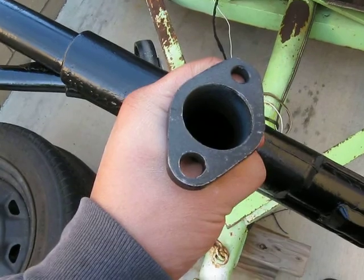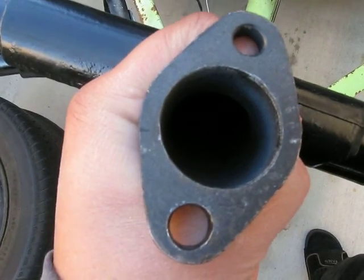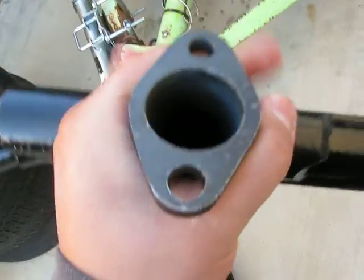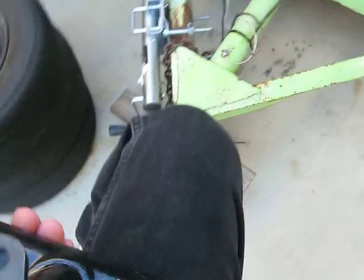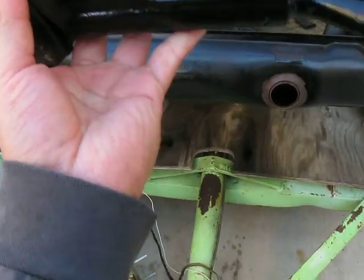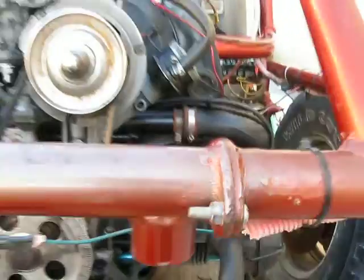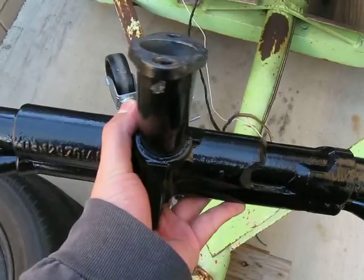Now here's my question — I think I might have something from Europe. This manifold is meant to mount the newer replacement H30/31 PICT carburetors, or the 30 PICT-1 carburetors — those small carburetors. I didn't pay attention to that because it's a dual port intake manifold. It wasn't until I started putting it on that I realized the ends here are a little smaller and fit a little more loose in the end castings. I figured I'd just clamp the intake manifold boots on tight to avoid vacuum leaks.